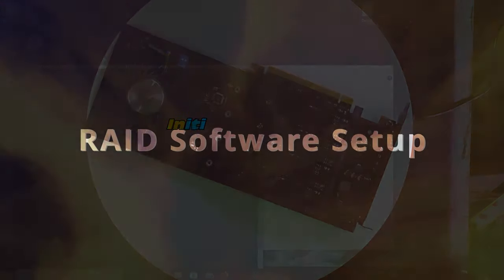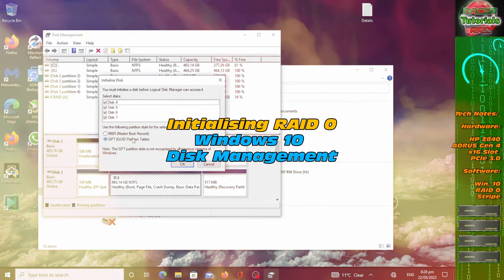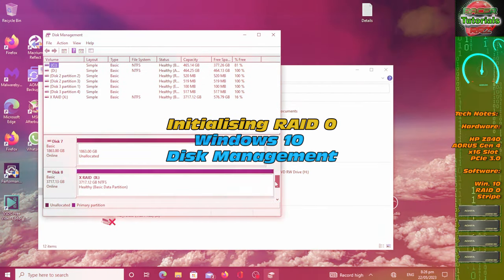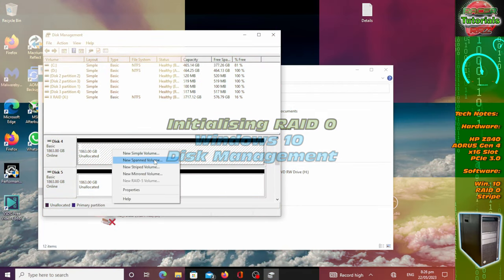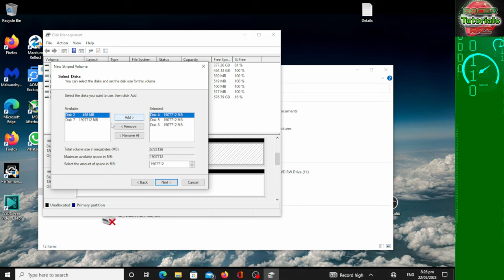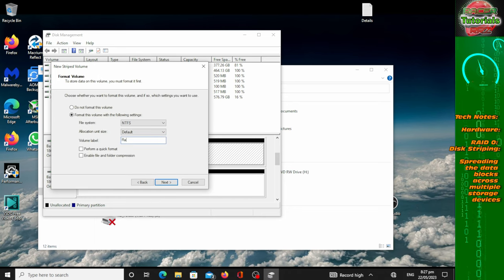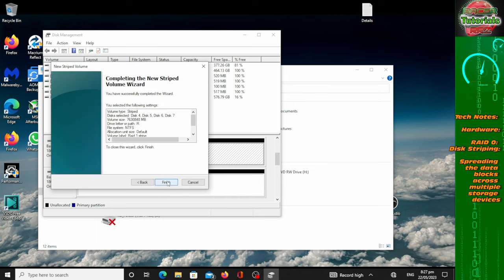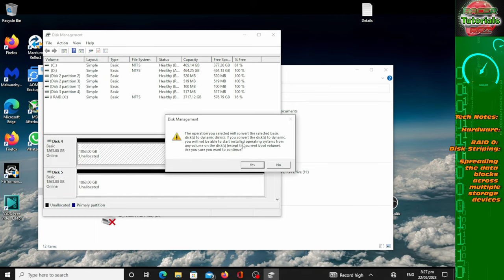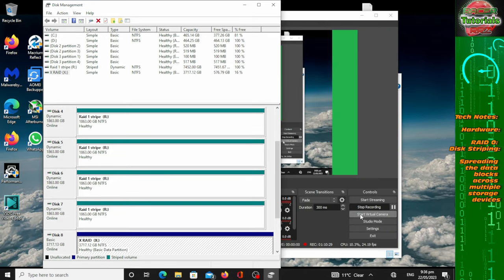So how do we do this on Windows? I'm a Windows user — forgive me for that. Let's go for a striped volume in Disk Management within Windows 10. We're going to add all four of these NVMe's to our particular volume and name it RAID 1 Stripe — not because it's RAID 1, but just because it's the first test. There will be four of these coming out for independent tests. But technically it's a RAID 0, so keep that in mind.